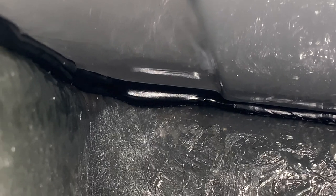Once it's in place, this is the join between the side of the van and the inside of the fibreglass side pod. Here you can see the step where the van sort of sits in a little bit, so you need a wider thickness of glue between the pod and the side of the van just to take up all the space. It looks like it's got a good seal — I'm happy with that.